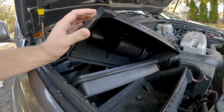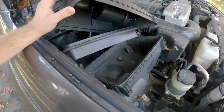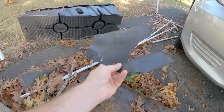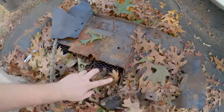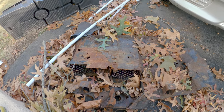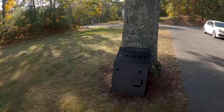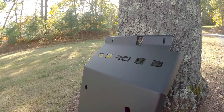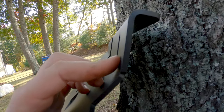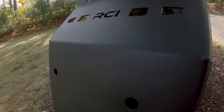I got new snap-on fender flaps on both sides — they help prevent water and dirt from splashing up into the engine bay. I also deleted that terribly stupid charcoal filter in the air box, and now I've got a little better throttle response. Finally, we tore off the old rusty, crusty skid plate along with the old rubber splash guard — those covered in leaves aren't going to do much if a rock tries to puncture them. So we ordered a skid plate from RCI. This thing is the real deal — very heavy, I forget what gauge steel, but it's literally bulletproof.